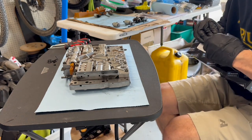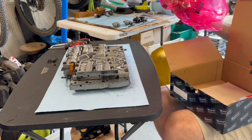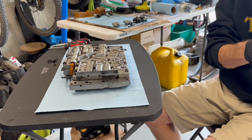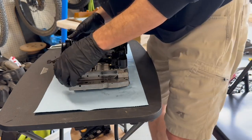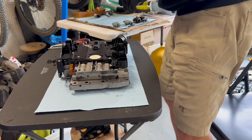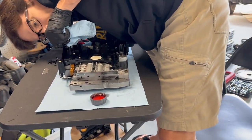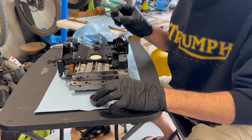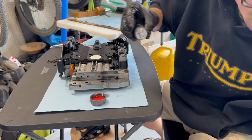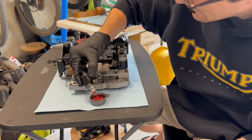New pan, and very importantly a new apparently OEM conductor plate from Euro Parts. It doesn't have the MB logo on it but looks pretty good. One clicker, two clickers — new conductor plate which we're going to drill a hole in today. Click. I'm going to double-check that one — yeah, it's seated. This one pushed in and then it like fell seated, and then I saw it actually pop in. These literally just push in; they're an interference fit and they felt like they pushed in pretty good.